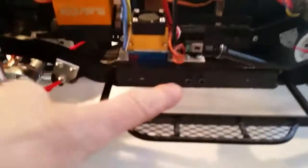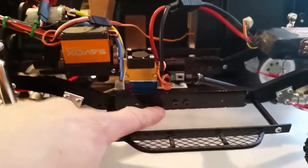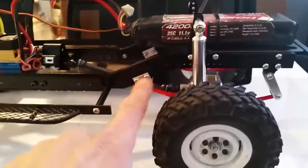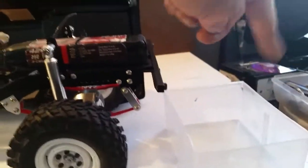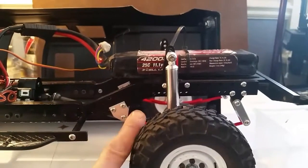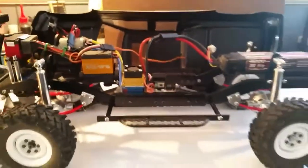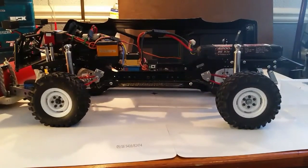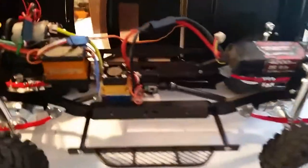I filled in the gap with a thick aluminum plate so it wasn't hollow where I chopped it. I had to do it in the middle because the angle goes back — extending out the rear would have changed the ride height and shock mounting locations. I was very cautious when I chopped it in half, but it's holding together phenomenally well with no twisting.